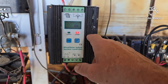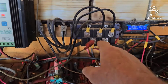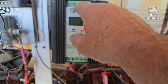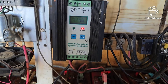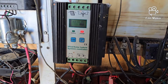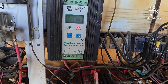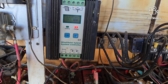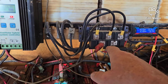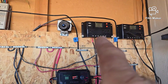So what I'm doing right here is running power from the wind turbine through to the rectifier to turn it to DC, and then coming off that with two lines into the solar input of the unit. As you can see it's saying 'charge,' so the wind is blowing a little out there right now and it's charging the batteries through the solar input. I did this just to see what would happen. Yes, you could use any charge controller — out of a rectifier and into the solar input — and it'll work to charge your batteries.